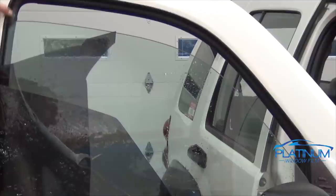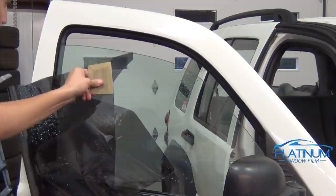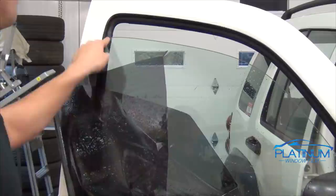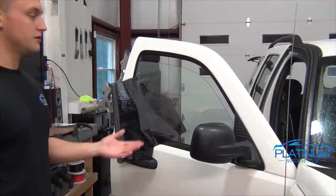Take the straight edge on this side too. Remember this corner — you've got to think about that when you're cutting this edge. This part is straight but right here it does curve a little bit. So take that straight edge and bend it a little bit this way to replicate the bend in the glass at this corner. Take your finger and make a nice round edge. Now we're going to lay the tint out on the window and prepare the window to take the tint on the inside.